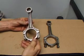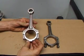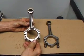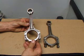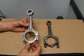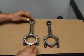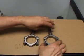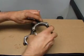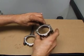One of the newer technologies that we're seeing in modern engines is the sintered rod that's made from powdered metal. It's pressed together and then put into an oven where it's sintered, meaning the granules are melted together and they form a nice monolithic piece. This happens to be out of a 4.6 Ford. What's interesting about this rod is that the parting edge where the cap and the rod meet is fractured, so each cap and each rod is going to be unique unto itself.